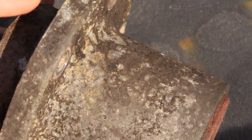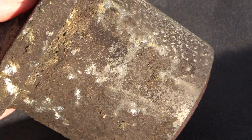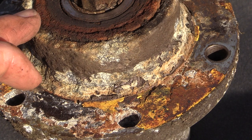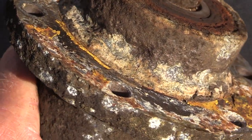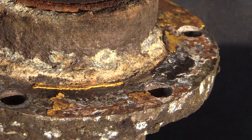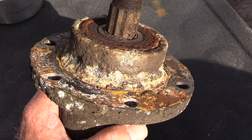Over here — you probably noticed these already. Listen to the sound these things make. These are front forks, and it's the same old problem: they're all out of round, all gouged and messed up. So even if you put fresh bushings in, the whole thing rides cocked. It has new bushings in it and it still rides like that. These new forks will fix that — I got two of those.